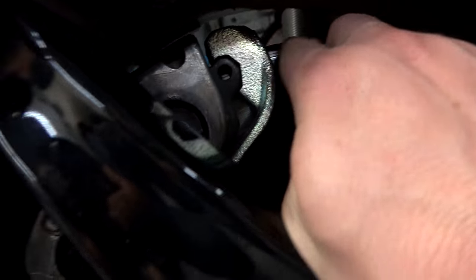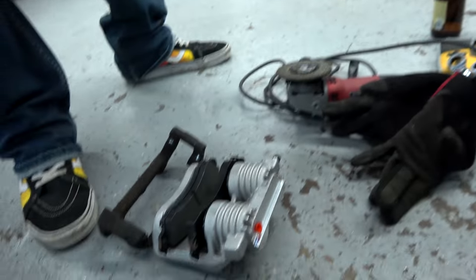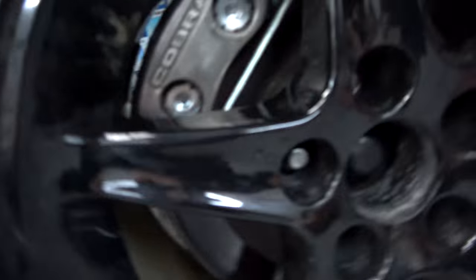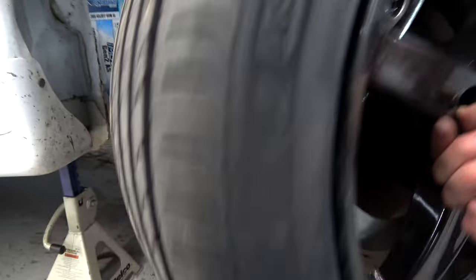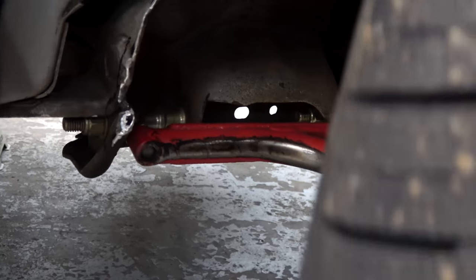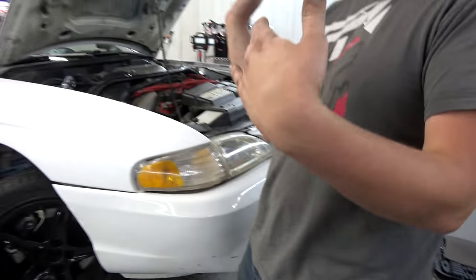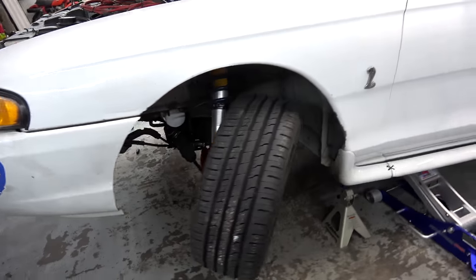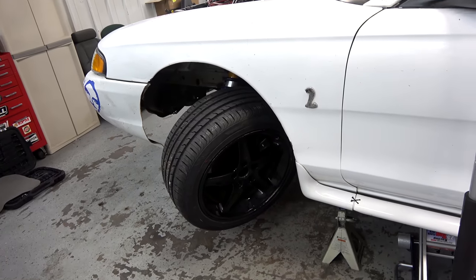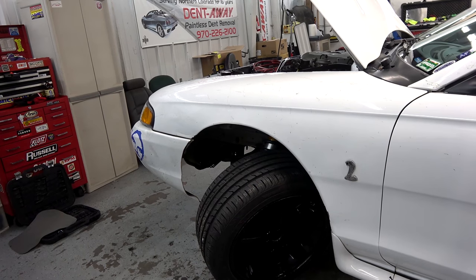You could go out further by extending the arm and changing tire size, and with a larger wheel spacer you could get some crazy 85 degrees of angle — like the full shopping trolley thing. But honestly, that's pretty good angle for all I need. That's more than I need at this point in my career. If you're driving with that much angle you're doing some gangster stuff anyway — it's gonna be hard to sustain that kind of angle.